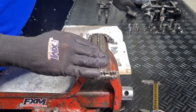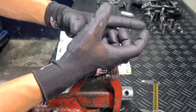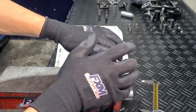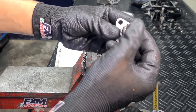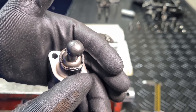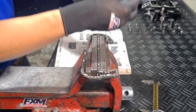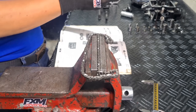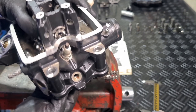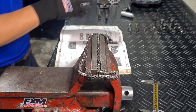Now we verify our chain tensioner — this movement is completely normal, and the wear shown is normal, not a replacement item. Now we're going to replace our valves, which already have play at their seat. When there is play in the valve guides, the valve works poorly — it wobbles continuously and can generate damage to the valve stem. So we're going to replace them.